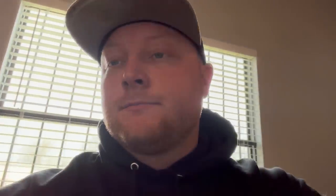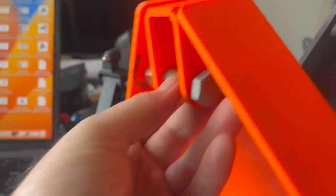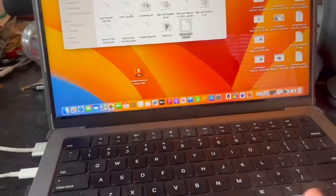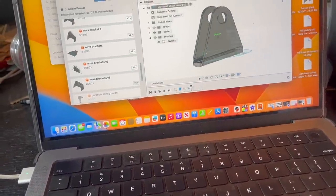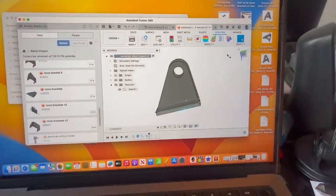Okay, one small problem — not with the bracket, it's with the shock mount. Since I made this taller, I'm going to have to do cutouts like this to get the bolt and nut on there. And this bracket right here is now too close to the edge to do these. So I just had to move this hole back a quarter inch. I came to my laptop and drew up a new bracket with those holes moved back a quarter inch. So I got that printing now.